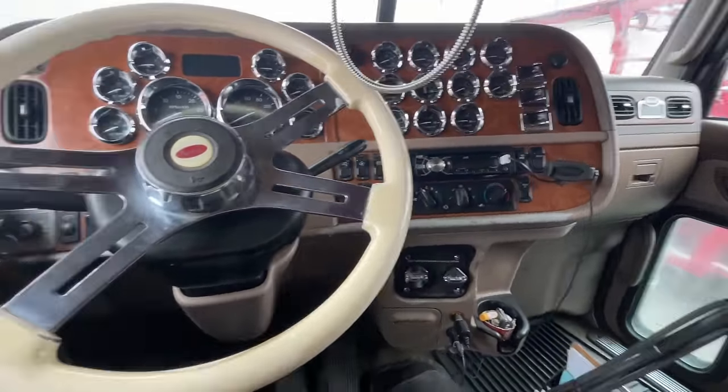If you're going without double clutching, then you kind of have to pop it out of gear with the throttle. So you give a little bit of a blip to pop it, and then rev match to get it into the next gear. Blip and there, blip and there.